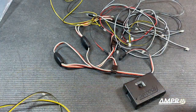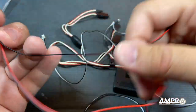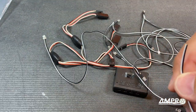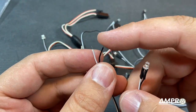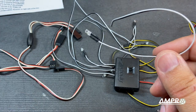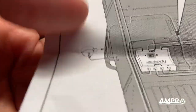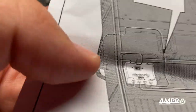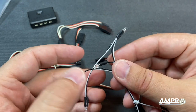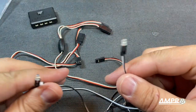The yellow LEDs have two close to each other and one far away. Both red lights come off of one signal, which is kind of cool. One white LED appears to be missing its connector — I looked in the package and found the other half. The reason that wire comes in two pieces is because it has to be fished from the outside of the body to the inside, so the hole required is a lot smaller. There are also two white forward LEDs close together, and one set spread apart that will probably be for the reverse lights.